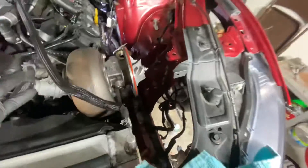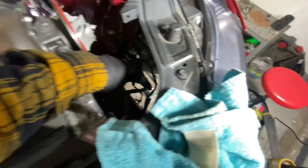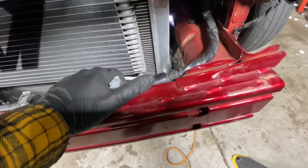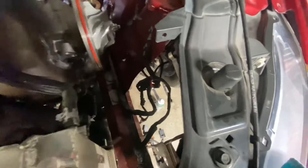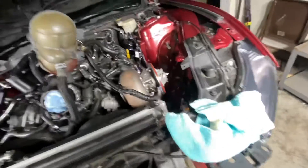I needed to see how it's going to fit and how I'm going to run my intercooler. The turbo housing is going to go right here, and I should be able to come through this gap — the intercooler is going to sit right in here. I may not have to move my fan; it might just be a matter of relocating the radiator about an inch back.